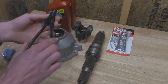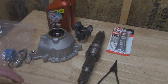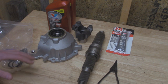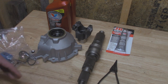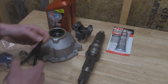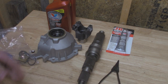Those cheap adjustable snap ring pliers don't open snap rings wide enough — they just bend. These retaining rings don't have little ends on them, so they're not true snap rings, more like retaining rings. That's why the ends are flat. Pretty much all the snap rings on this install are external snap rings, so we should be all set using this tool.